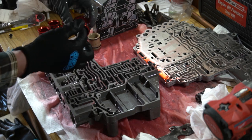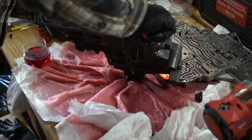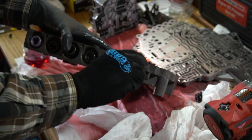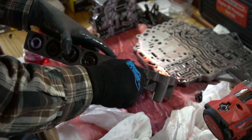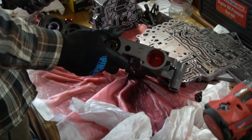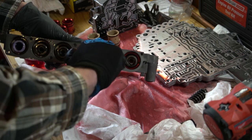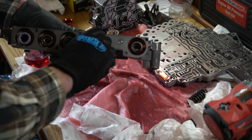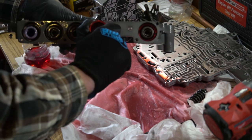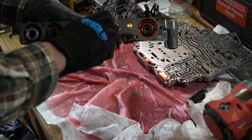I'm going to get some fluid on these seals and get them as lubricated and oiled up as I can. You don't want to just jam these and try to shove them straight into the bore — I'm just trying to spin them a little bit to get these seals to seat properly. It looks like they'll both go in; I just have to spin them a little bit and slowly work them into position. I've got our first one in the hole — go ahead and stick this set of springs in there. These suckers definitely create a vacuum and a seal — as soon as I get this seal to start in there you can feel the suction on this thing.